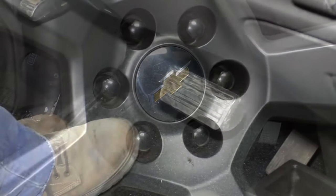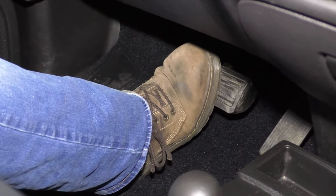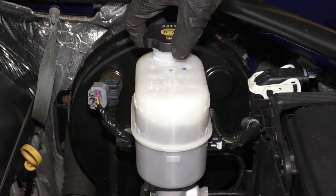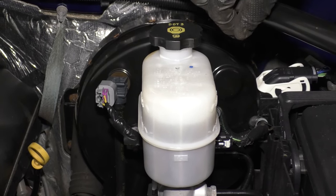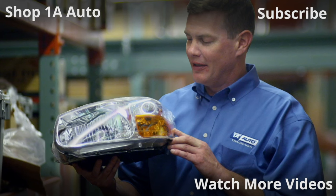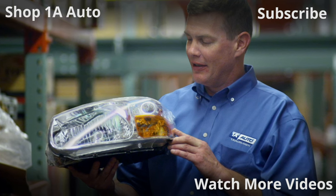We're good to go. Afterwards, we want to make sure we pump the brake pedal. There's going to be an air gap between the caliper piston and the brake pads — we want to eliminate that air gap by pushing down on the brake pedal. After that, we want to check the fluid level in the reservoir for the master cylinder. Make sure the fluid level is at the proper location and adjust accordingly. Then you'll be good to go. Thanks for watching. Visit 1AAuto.com for quality auto parts shipped to your door, the place for DIY auto repair. And if you enjoyed this video, please click the subscribe button.